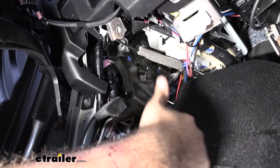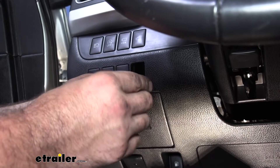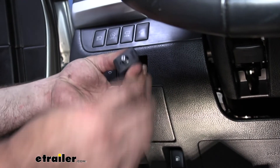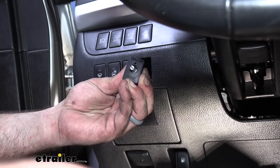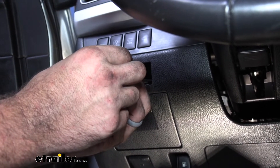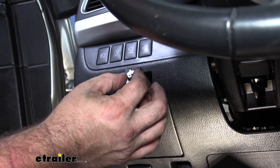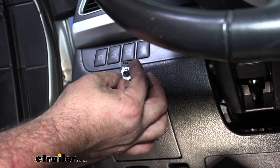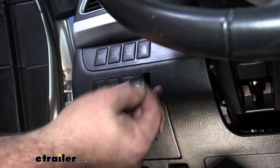It's going to have clearance of the emergency brake here. Turn this all the way counterclockwise — that way it's zeroed out. And then we're going to fit this in there. It can only go one way, so if it's crooked, just flip that around. All the way turned to the left means that it's going to be at zero. The great part about this is you can mount the knob exactly how you want it. There's a sticker here that's included, and this is going to have a little point to let us know where it's zeroed out — you don't have to use it, it's kind of up to you. But I'm going to go ahead and get this placed on there, and that way when we put our knob in place it's going to indicate exactly where we're at.